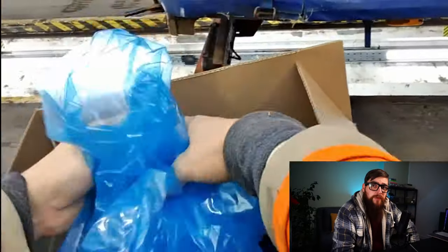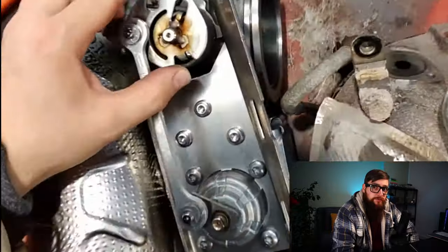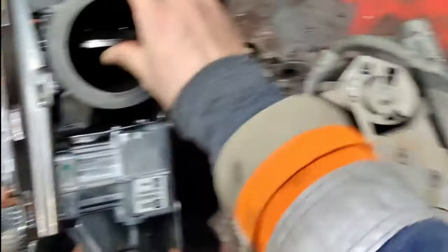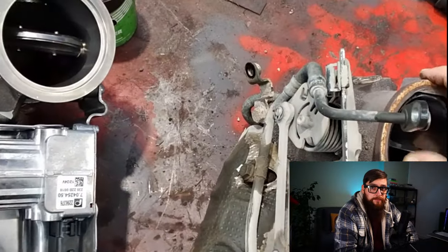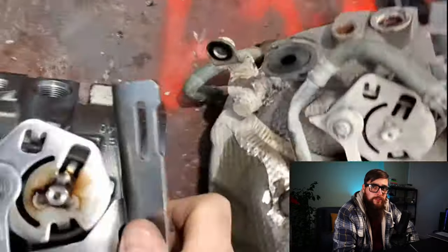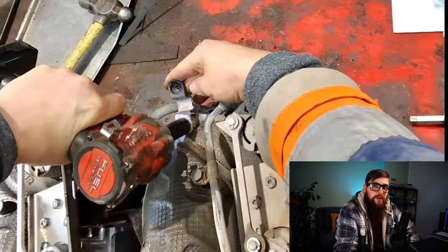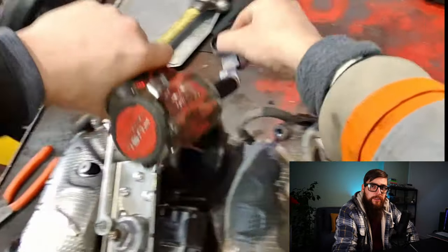With our new BPV out the box, I can show you what fails and what causes one of the fault codes, which is failure to reach position. As you can see, the butterfly valve bearing has collapsed. This is operated by the electric motor, and when the vehicle attempts to regenerate it usually fails to reach its target position, throwing a DTC. Unfortunately, the butterfly valve and bearing is a non-replaceable item and the whole BPV assembly needs to be replaced.